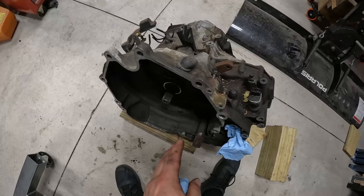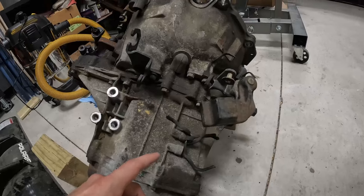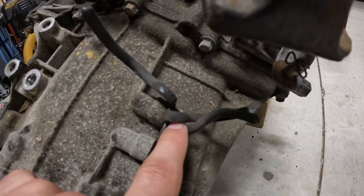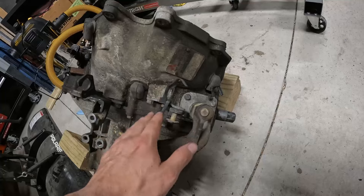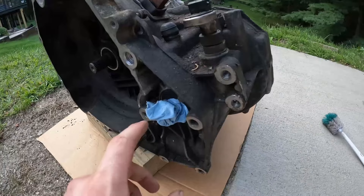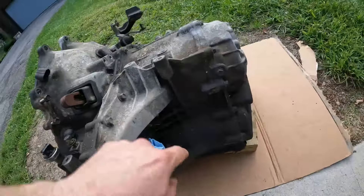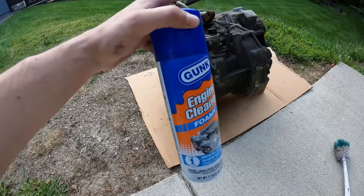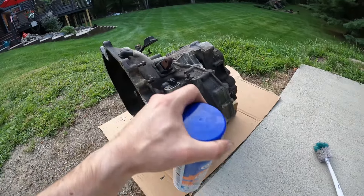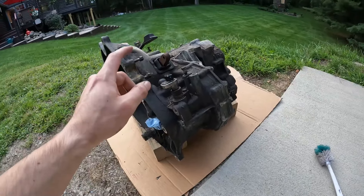You can see it's definitely a lot darker and gunked up over here - looks like something was leaking. We're going to get all this cleaned up nice before we disassemble it because I don't want any of this crud to get inside the transmission parts when we take it apart. I hit it with the shop vac real quick to get all the loose stuff, and I'm also going to remove all these wire pieces - they're just held on by bolts. I've plugged up both of the axle seals so we don't get water or degreaser inside the transmission. We're using engine degreaser, spraying it all over, letting it set for about 15 minutes, agitating with a brush, and then pressure washing it down.